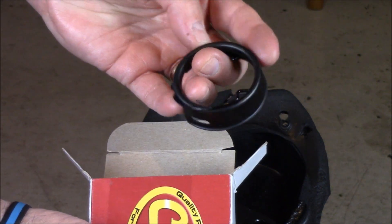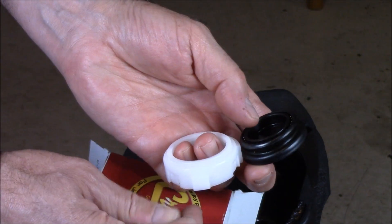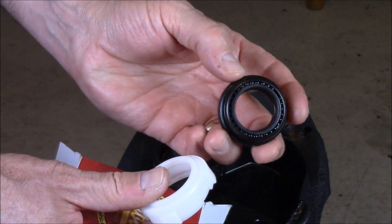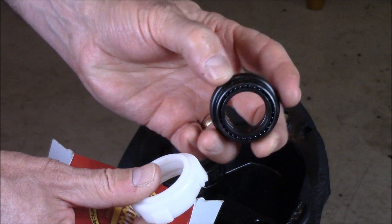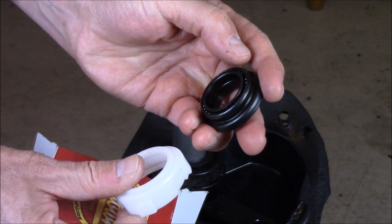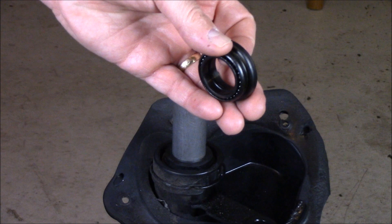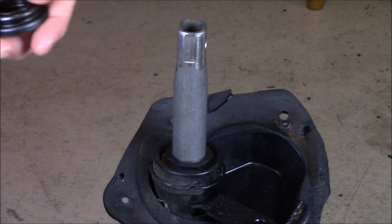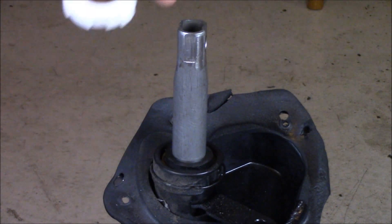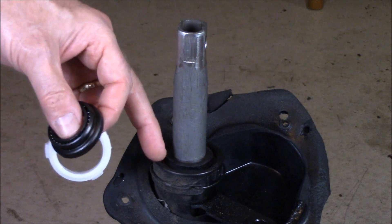So the kit comes with your outer retainer, the clip, the inner bush, and the bearing. On the Jeep seats they give you this nice ball bearing — a lot nicer. I'm going to pack this with a little bit of grease, then put this together, take the old one off, and put this on. It's kind of an easy job — as long as you can get the intermediate shaft off and scoot the bearing out, it's not that hard. Let me take you through it real quick.